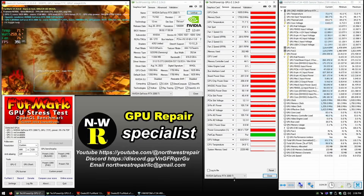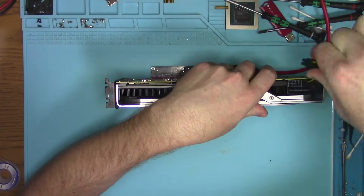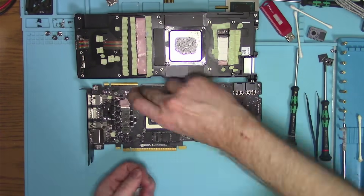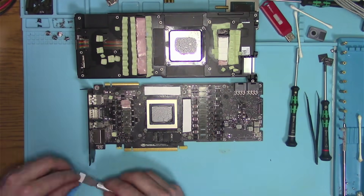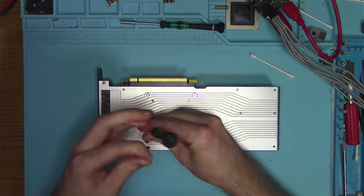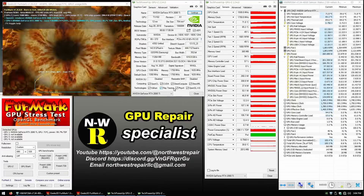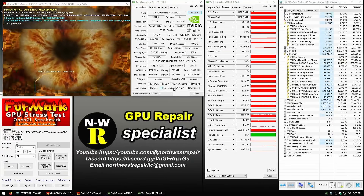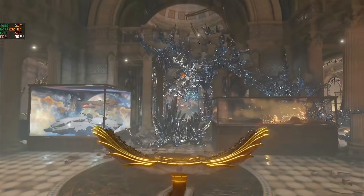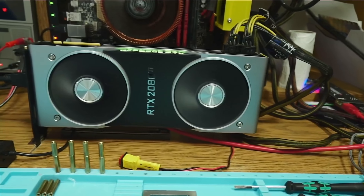Little too much on the delta, about 17 degrees, so I decided to reopen and check if everything is as it should. It looks like I needed thinner pads, so let's put thinner pads and try again. That dropped about 3 degrees — not exactly what I was expecting, but oh well. After all, this is Founder's Edition.